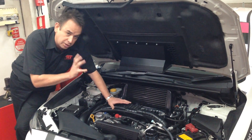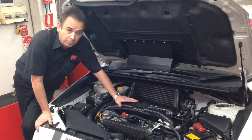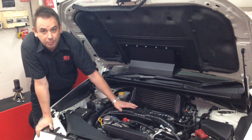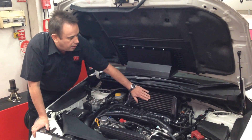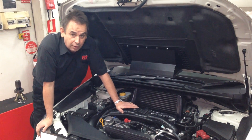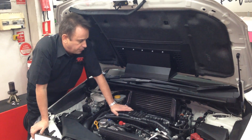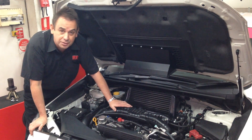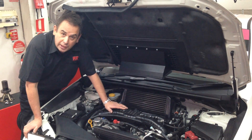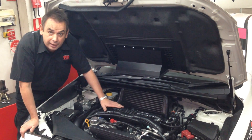The big advantage you might want to know is what does it actually do and how does it work? The advantage of a top-mount intercooler on a Subaru is all about heat efficiency and maintaining the coldest inlet charge while the engine's under load. Depending on your airspeed — as in driving down the road — this intercooler is totally reliant on the airspeed of the car moving forward. If you don't have a lot of airspeed going through the intercooler, whether factory standard or aftermarket, you don't have the cooling ability to reduce the inlet charge. Typically, the temperature drop across the inlet side to the outlet side is about half, and we're going to see inlet temperatures of anywhere between 40 to 80 degrees depending on what intercooler design you're running.